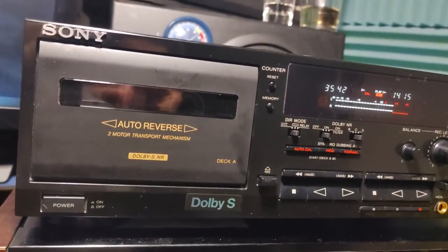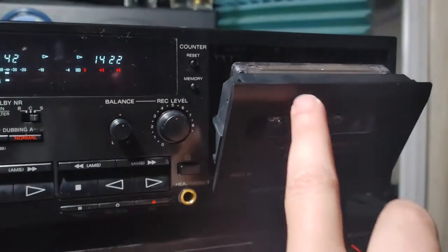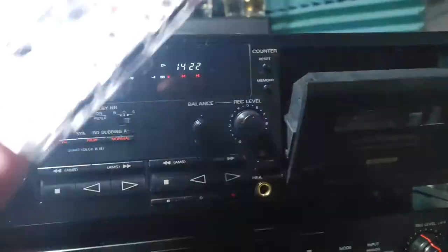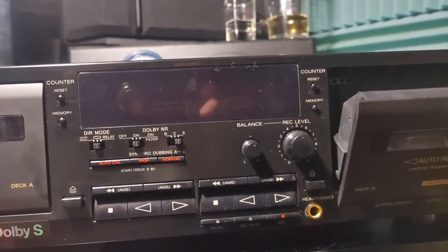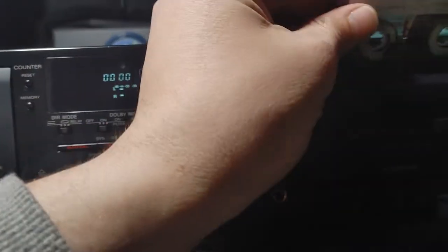So that's how that goes. We need to put in a new tape because the deck is somehow able to recognize the tape that you calibrated. See, the CAL indicator is on because this cassette tape is already calibrated — it will recognize the tape, probably by the type of tape. If I put some other tape — this is a different, still Sony HF — the calibration is still on. I believe the deck memorizes calibration by tape type, so if you're using the same kind of tape you don't have to calibrate every time.